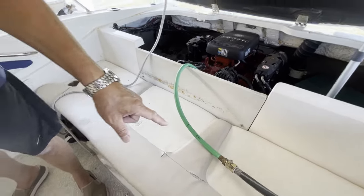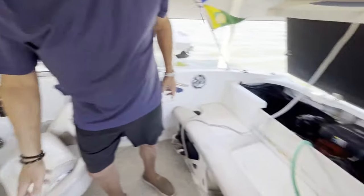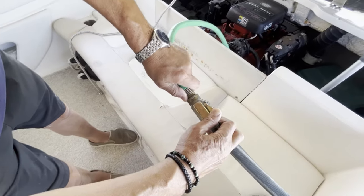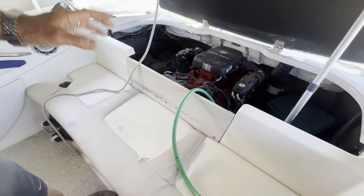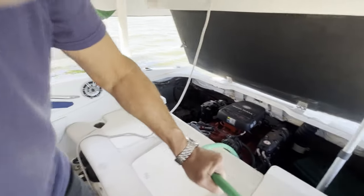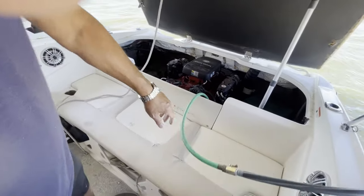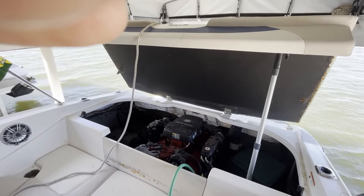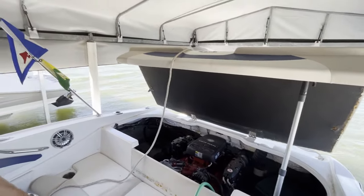We're going to turn it on and immediately start the flow of water. The engine is running but it's getting no water — now it's getting water. You can feel the water flowing in the hose. If you have a friend on the dock they can look down and verify that water is coming out of the engine — that would be helpful. But if you feel the water flowing through the hose with your hand, you're good to go. We just run the engine like normal for maybe two minutes — it's probably pretty quick for the water to circulate through the entire engine.